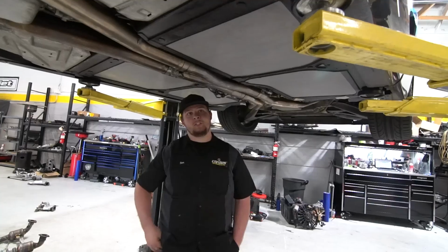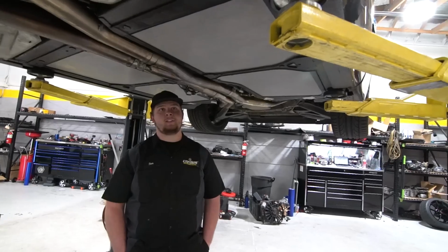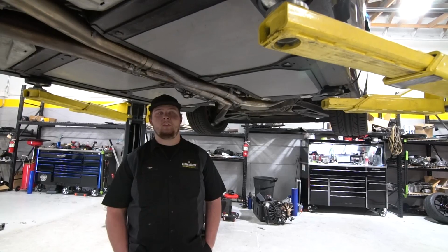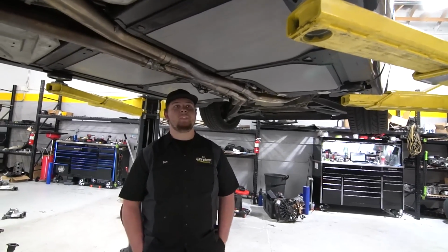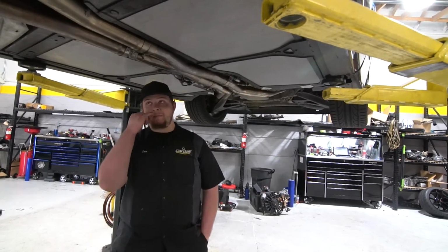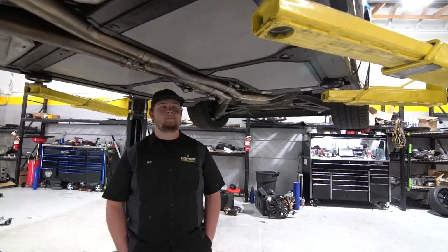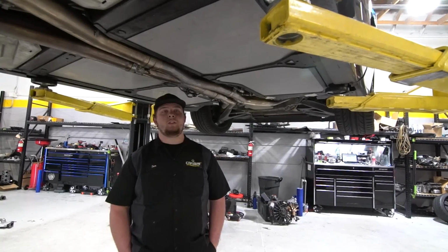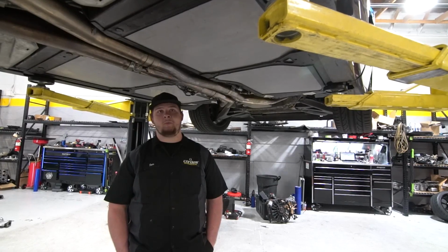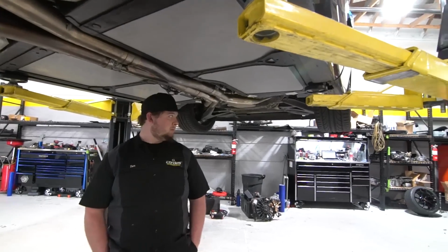We were talking about an auto C5, like a base model C5, for like $8,000, but I'll have to put a trans in it. Right, 460. So there's another couple grand right there. And then like 2,500 plus a converter. Yeah, $1,000. And then all the stuff with the motor and everything. We started talking about it, and I was like, if I could find a clean C6 base model that's auto and LS3, I might do that instead. Because then I don't have to do a trans. I just put a converter in it. Don't have to do anything to the motor. Like this thing's a cam-only car with the blower, and it's solid.